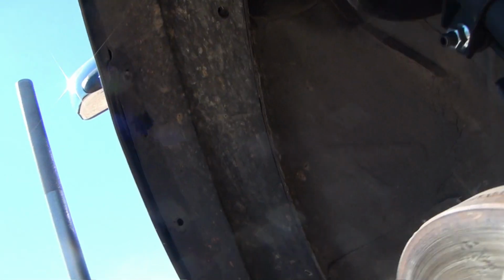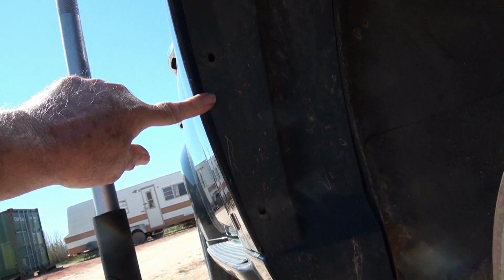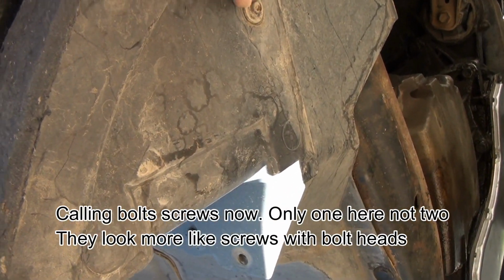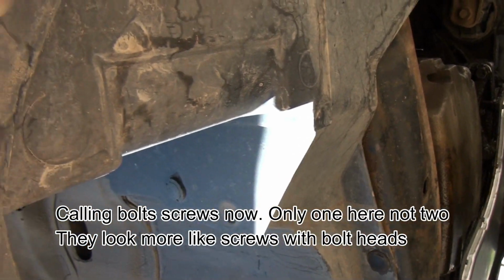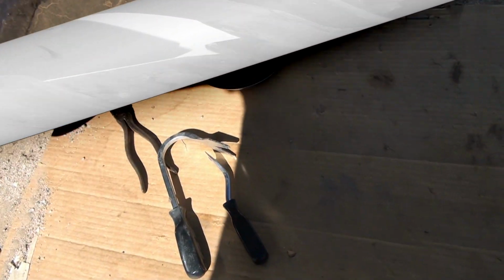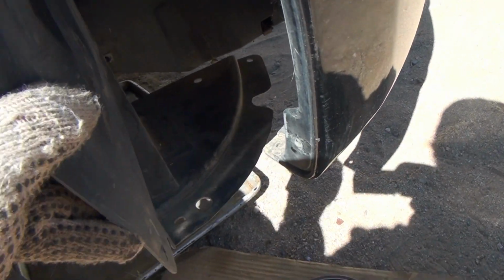This outer fender has insulation behind it, and it goes in front on this, and then as you go up it goes behind the fender, and then it comes back out in front again. Well, I found the other 2 screws. There's one right here, almost under the front bumper, and there are 2 more clips, and then I should have it free. Just a note, if you need to get to your marker lights on the side here or your fog lights, just by removing this bottom piece and the connectors to it, you can get up in there.